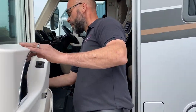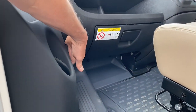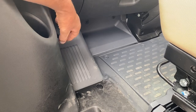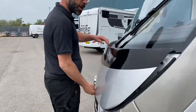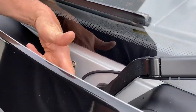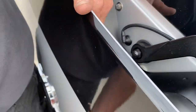We'll start under the bonnet, which is a bit tricky to get to. The bonnet catch just lives just around the corner here — if you can see that on the camera, just pull that forward. Then we come to the bonnet — there's a bit of a knack to doing it. There's a secondary catch just in here with a red lever on it, so just pull that to the left.